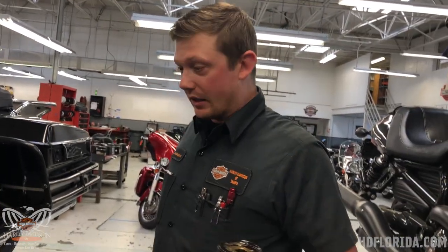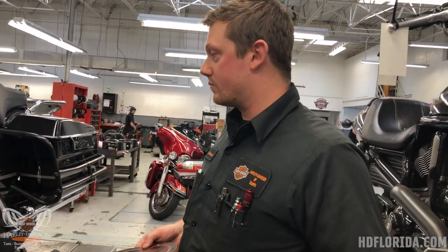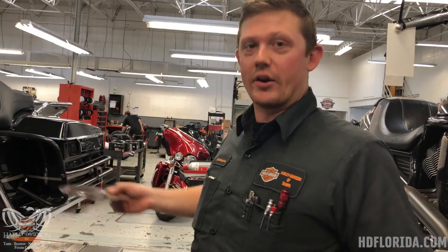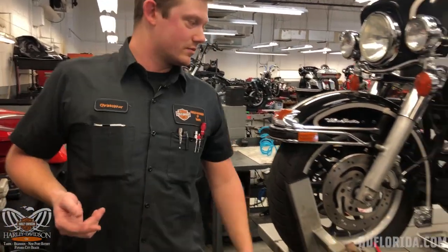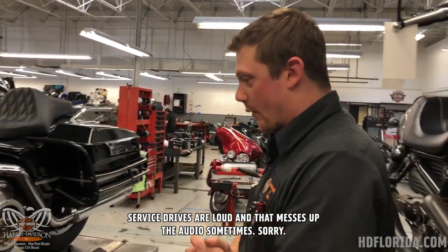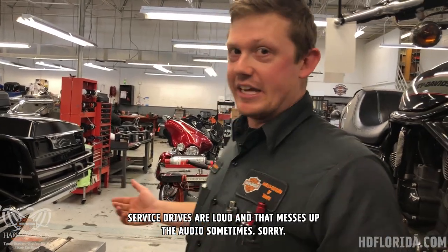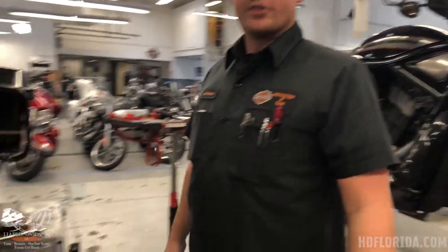In my experience, there's no way to remove your oil filter without creating a mess, so embrace the mess — be ready for it. As you can see there's only a few ounces that come out, but if you don't have something there to catch it, that's enough to be stressful in the garage. So far what I'm seeing and smelling, it looks like this motorcycle is maintained properly at the proper service intervals. For 75,000 miles, this is not 75,000-mile oil — this is a few-thousand-mile oil, which is exactly what we want to see.